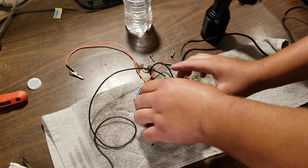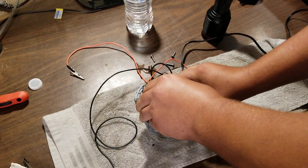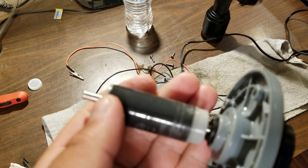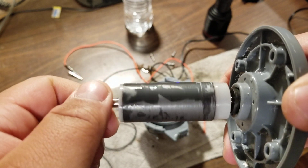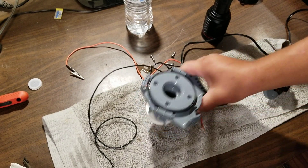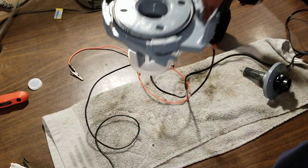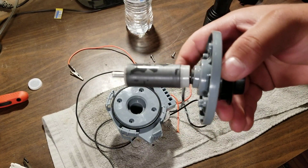Upon looking, you just pull out these four screws here. Let's unplug this from the wall. As you can see, this is almost like a shaded pole motor. You've got your ferrite core — or in this case, the rotor. It's a little wet; there is water in here, and I'll explain why in a minute. But all it is is just a north and a south, controlled by the electronic module inside. Right here there is a hall effect sensor — it knows which position the rotor is in, which pole of the magnet, and whether the rotor is actually spinning or has jammed.